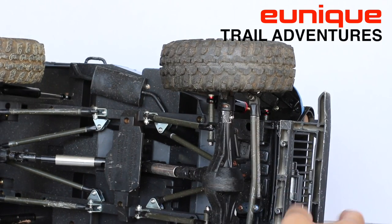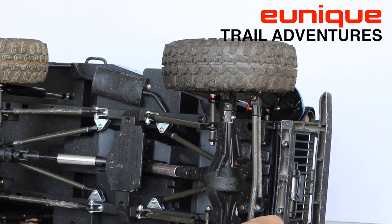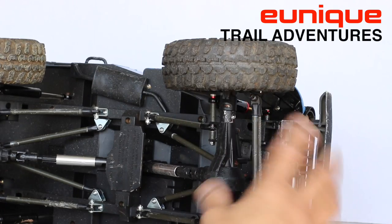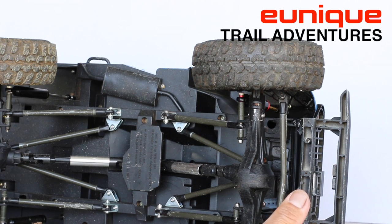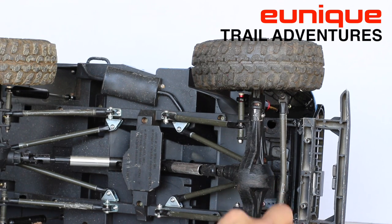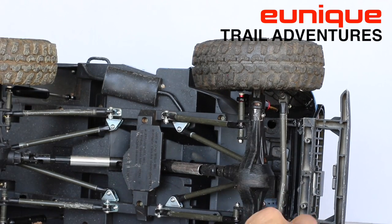For this one I'm using Axial axles with extenders on here. This is actually a very solid setup — inside I'm using a lengthened Axial axle for the proper width at this scale, both for the wheelbase and the track width. Inside I'm using Axial universals that have been cut to length. This is called the AX mod. These universals from Axial are pretty bulletproof — I've cut them down to size so they fit in and extend out with stronger inner shafts.